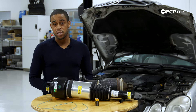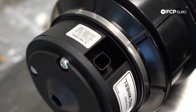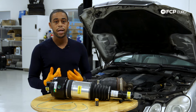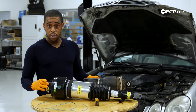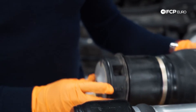Basically, the way the air suspension system works, you have a valve block and the solenoids that control how air enters or leaves the strut. The air spring is controlled internally in these units on the W211 and the 219 models. There is a 3-pin connector on top of your air strut assembly, and you have an identical connector at the rear if you're dealing with an air spring.